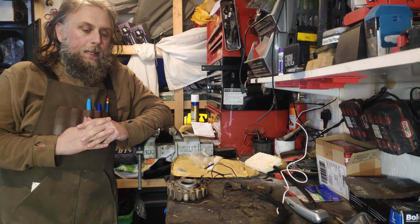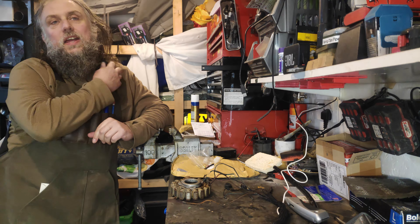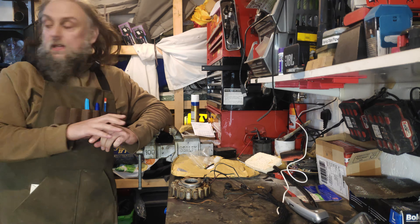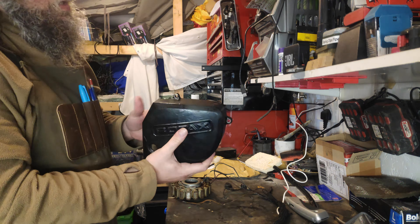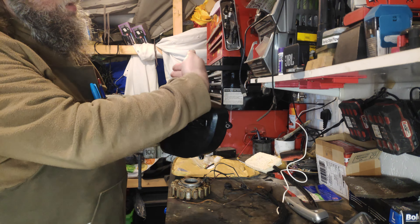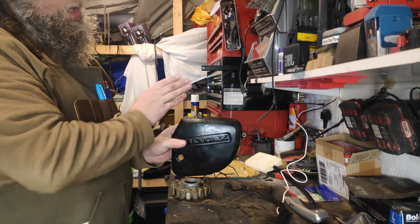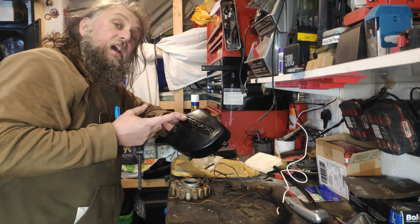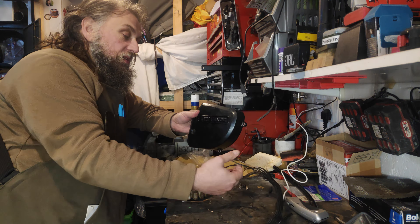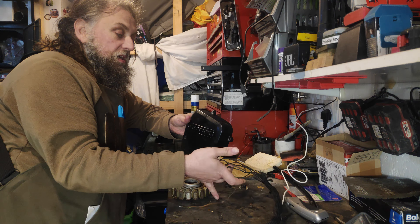Well, it's been a little while. This was in far worse condition than I could ever have imagined. Where it comes out of the casing, the exhaust passes pretty much right past it, and there's supposed to be a heat shield fitted to this bit here. This didn't have it, which would explain why the wires are in the state they are.